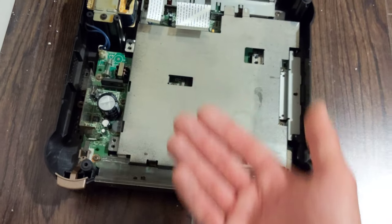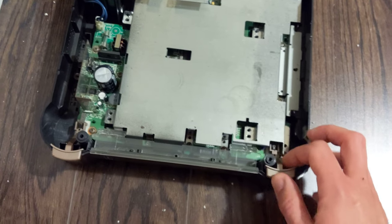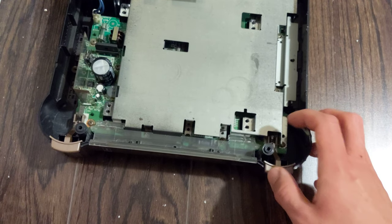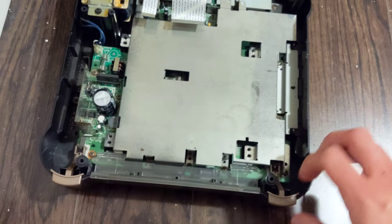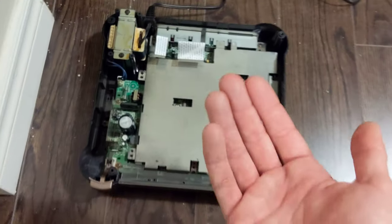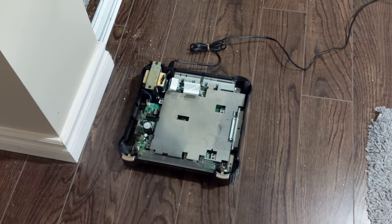It won't start, but once you get into it, you can manually take it out, put a disc in, confirm operation. I was able to get mine open by angling it out of the way, lubing up some of the gears, hitting the button, and it would kind of weasel its way out — but that needs a fix. That was just a way to find out if it works.